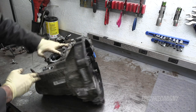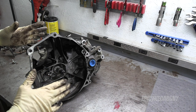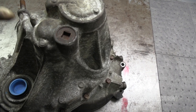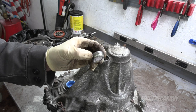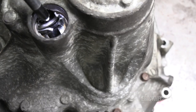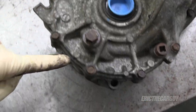Now I'm going to flip it up on its face. There are no dowel pins in this transmission case at the moment, but if you have them you might want to remove them first, or know it'll be a bit rocky when you flip it. Next, remove this plug — it's just a half-inch drive, spin it right out. The reason we do that is because you can see a snap ring down inside there, and in order to get the case apart you need to open that snap ring. Now we just need to remove all the 12 millimeter bolts around the perimeter.